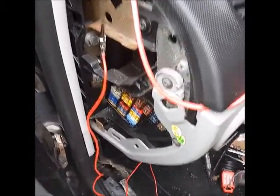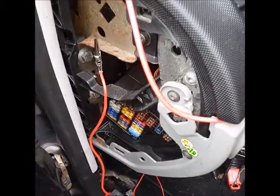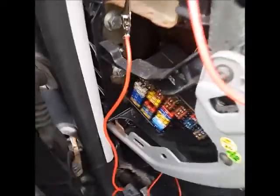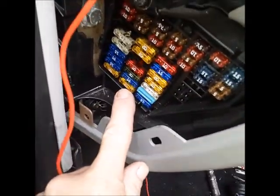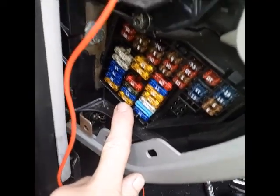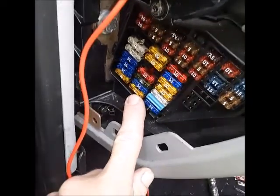I'm going to walk you through this so you can see what I'm doing. They say you've read the same articles: no check engine light, crank no start. First thing, go to the computer — which is fuse number 37. Check 37, it's fine. Then if fuse 37 is fine and we've got power there, they say go to the relay. The relay is right there — the 428 — we change that.